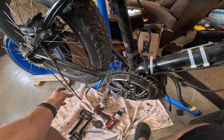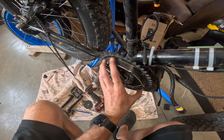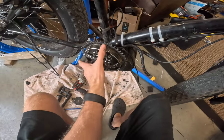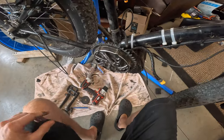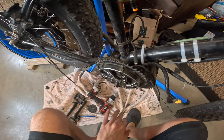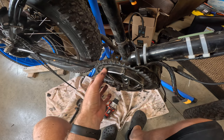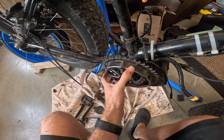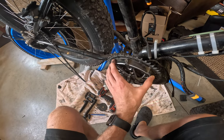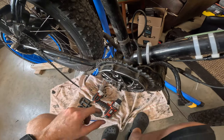There's no tension on the chain ring and we've got our motor free to move. It is just not moving very well — it feels really rough. Listen to that. It's actually hard to notice these noises and this resistance and lack of smoothness until you get the crank arms and the chain off and you can just spin it on its own. Yeah, that doesn't sound good — we've got to do some maintenance.